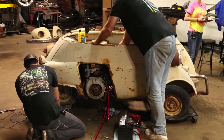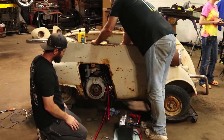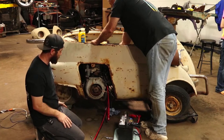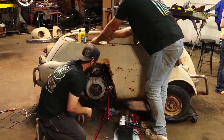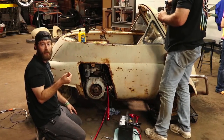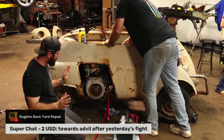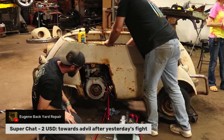Speaking of fire, this GoPro's fire. All right, so we know that we are getting fire to our plug now, so our coil is somewhat working. Hopefully it'll stay lasting. Let me disconnect it here. The longer it has power, it's basically like if you would have just turned your key on and left it on, it's sending juice to that coil the whole time. So sometimes they can overheat and burn up. So we most definitely don't need other parts not working for us today.